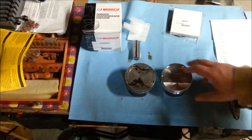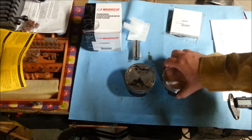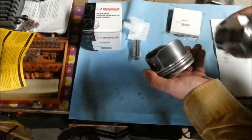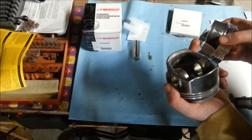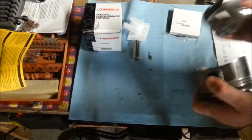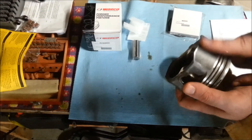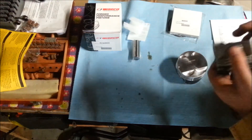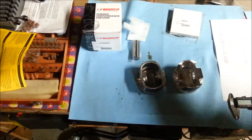These are stock diameter — 86mm diameter pistons or bore. Something I was kind of surprised to see was that Hyundai actually uses a coating on their pistons, and so does Wiseco. These coatings are only here for wear-in, for initial run — they're not here for the life of it. 60,000 km is an ingestion of a lot of oil, and this coating isn't nearly as bad as I thought it would be. It's a little more worn out on one side.